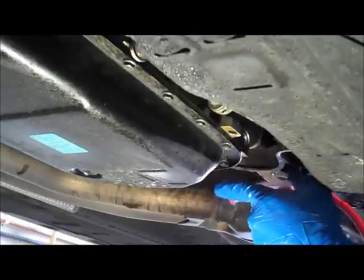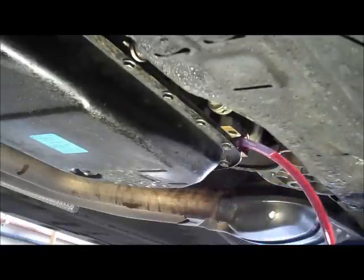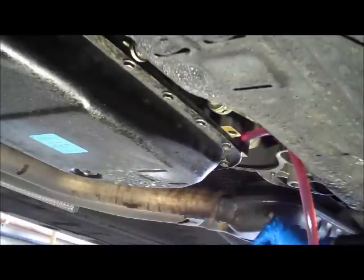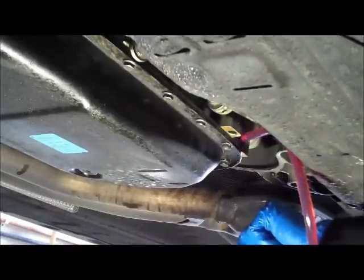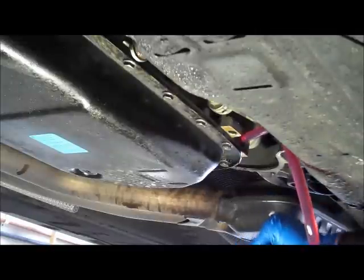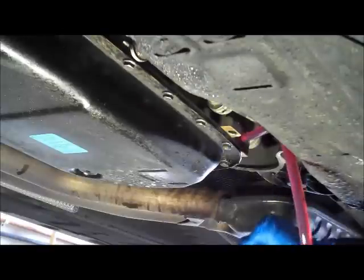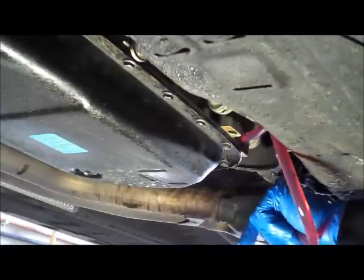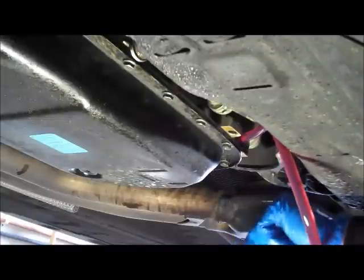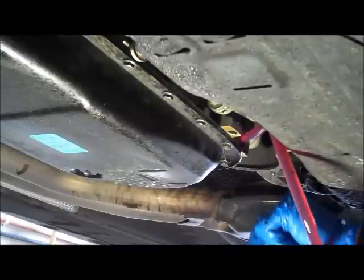For those who didn't believe me — you have to put transmission fluid in while the engine is on. Put it in drive as well as reverse for about a minute to get the transmission warmed up to 55 degrees Celsius, which is about 130 degrees Fahrenheit. Then just fill it until it drips out.